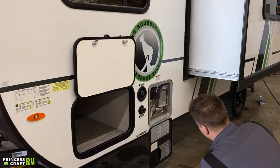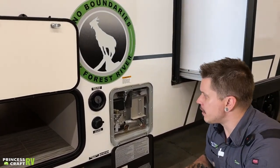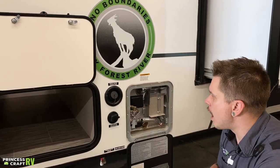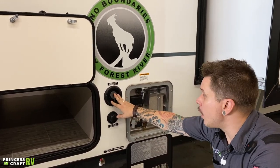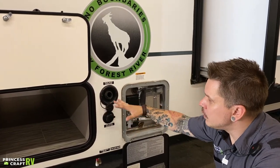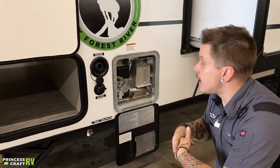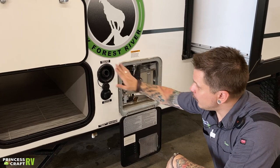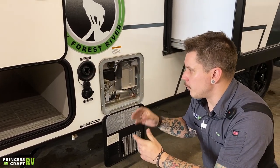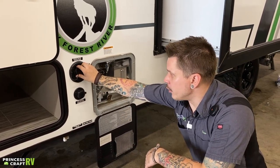Right here we have your freshwater connection. If you're doing any boondocking or off-grid camping somewhere where you're not going to have full-time access to running water, you're going to want to go ahead and fill up the tank here. This is non-pressurized water, which means we do need to use the onboard 12-volt water pump to draw that water up from the tank to the fixtures. To fill the tank, we stick a drinking water hose directly here, fill it up until it overflows. Once we're full, we cap it off and use that pump to make that water usable from the tank.